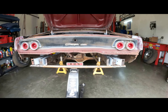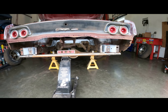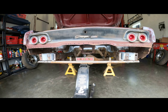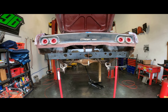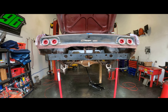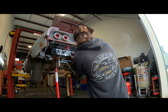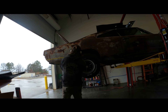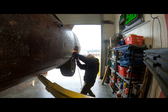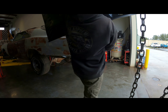Frame connectors are in permanently — it's going to be kind of hard to rip these out. Both sides done. Charger's back down on the ground, got my frame rails sitting on jack stands, the back is supported by a piece of tubing — bubble says it's in the middle. Starting to put metal in. After a short commercial break with some customer cars, the charger's back on the lift and we're starting to put in the rear cross member.